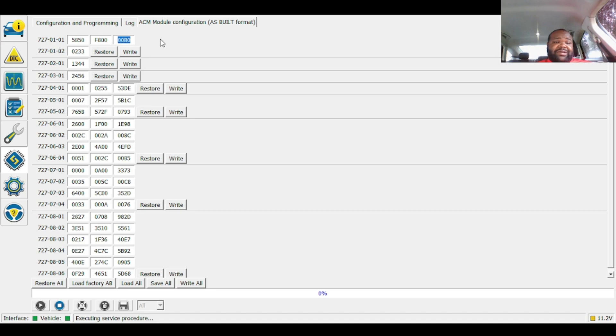Other than that, once you're done putting in the codes, hit Write. It'll write it up and send it over to the system, and you just cycle the key — that's pretty much it. If you want to copy the code how I got it — for the basic system with four channels, front and back speakers — just copy the code how I set it up. You don't have to worry about the pins in the back; just cut the speaker wires and those will be 4V pre-out to the amplifier.